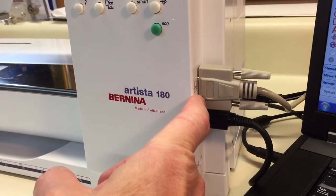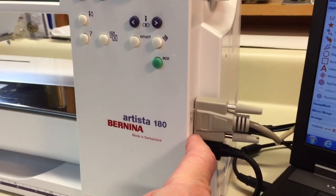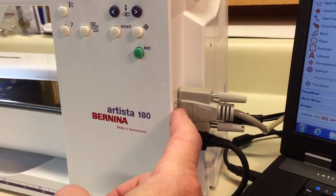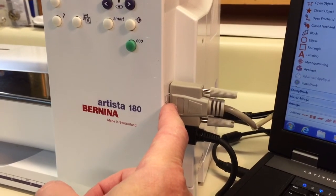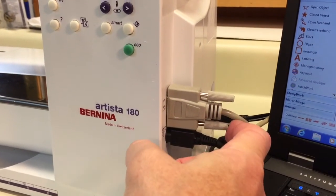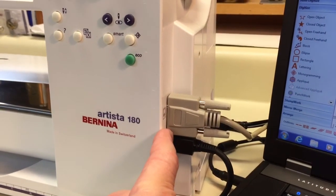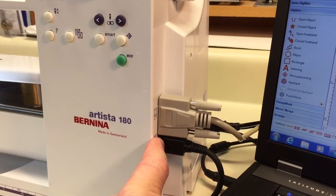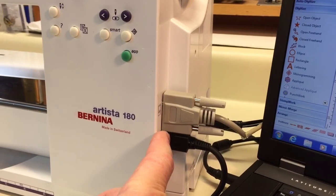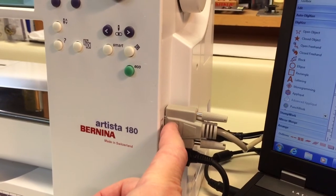I have another video that I posted years back on using an adapter to go from the 9-pin or DB9 COM port to a USB computer, but that adapter I show in that video might not be available anymore. If it is, the one thing you have to make sure of is you get the correct firmware from the Tripp Lite manufacturer that makes that adapter work.